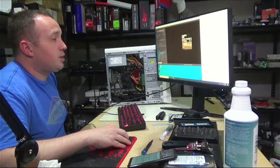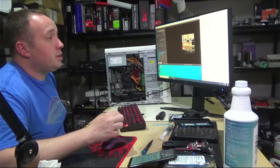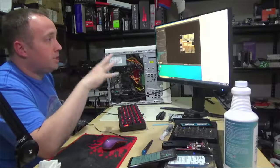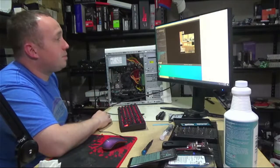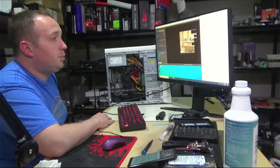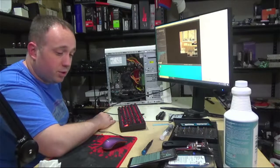So yeah, right now package power is 68 watts. That's with turbo, actually. And we're up to 61 degrees, 63. And I may need to power cycle this a few times to get the thermal paste to settle and get to all the gaps and get a nice even seat. But let's see how far we rise. And maybe I'm just cooler limited. Maybe 75 is just what this cooler's going to get.